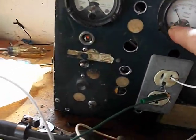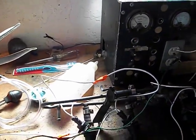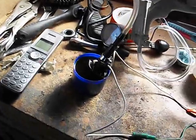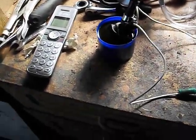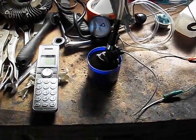I'm watching my amps and trying to keep it below about half an amp, which seems to be enough. It reads about 15 volts, so 15 divided by 5 — that's only 3 volts per injector. I also listened with a stethoscope. I don't know if these others are salvageable or not, or what you'd have to do to clean them — maybe an ultrasonic cleaner or something. I think these may be beyond just needing cleaning; they're frozen tight.